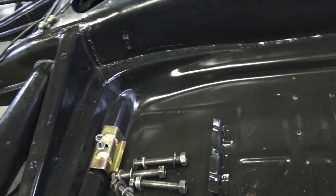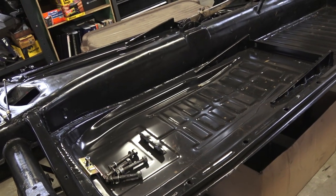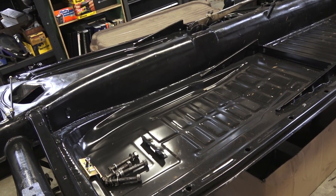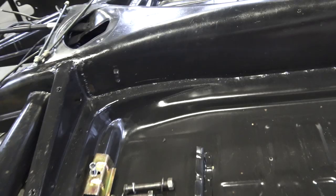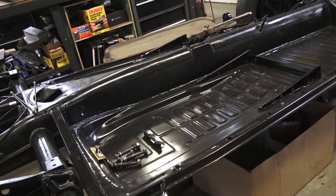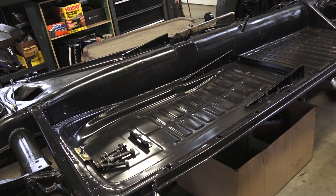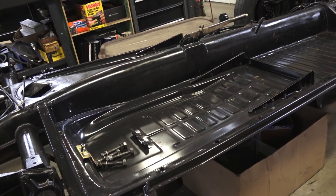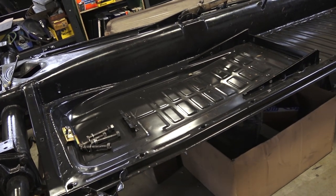So if the battery is in the wrong position and you sit on those springs, the springs could touch the top of the battery terminals. The only supplier I know that sells the correct floor pans for 1955 and earlier is Gerson from classicfab.com. His pans have the contour that cuts in wider — that's the correct fitment for your '55 and earlier beetle. He is a little more expensive, with shipping you're looking at about $300 a side, but they are 18 gauge metal.